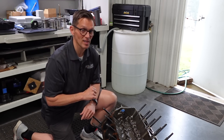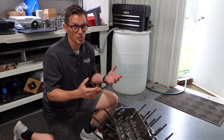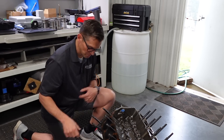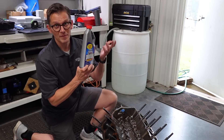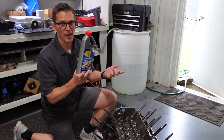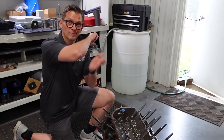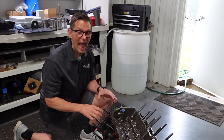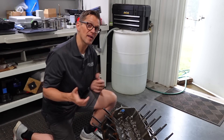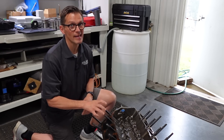The idea is to save as much material in the block as possible. The first step in this process — we've got aluminum in the cylinder wall. So to make it where we're not pushing that aluminum in with the hone, so it has to go further and further, we're going to use an old trick. We're going to use lye, which is also in most Drano or liquid plumber type products, along with a little bit of Scotch-Brite and some elbow grease to work in here and see if we can get that aluminum out of the cylinder. That way when we go put it in the hone, we're not moving all that aluminum around — we're just going to be cleaning up the iron.